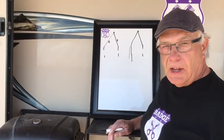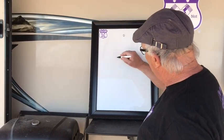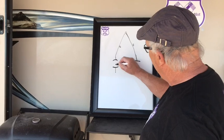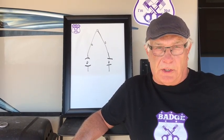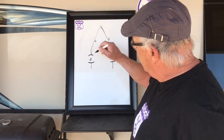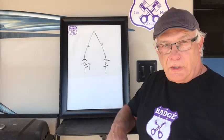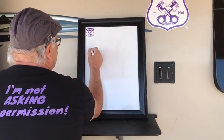I could see down the side. This is what you call trailer alignment - you have your tongue here and you have a tire and a tire. These measurements have to be the same, not even an eighth of an inch out, or else it pulls down the road crooked. Right now this number here is even and this one is minus one and a half, so this axle is moved ahead one and a half inches on this side, which caused it to dog track.